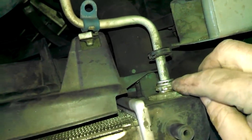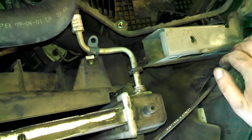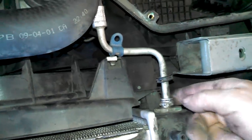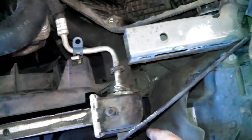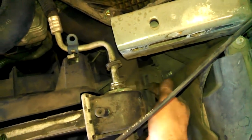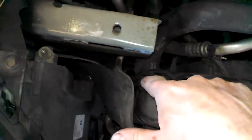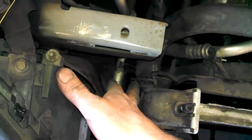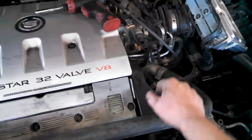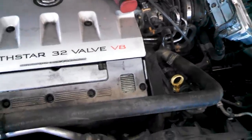There's a little clip in here. We'll get a small screwdriver and pop this little clip out — try to be careful not to lose it because you do need it to reinstall. The other option is to unscrew it too, certainly possible. You need to get a pair of pliers on the clamp here — they do make special tools for these kinds of clamps. Another option sometimes is to actually leave the hose on the radiator and take it off at the engine — definitely an option.